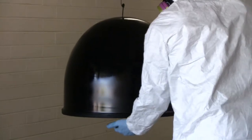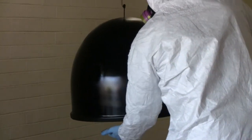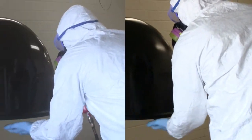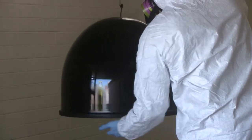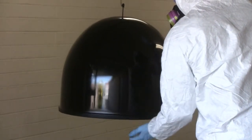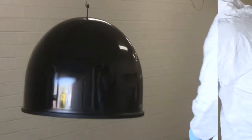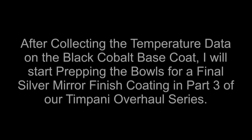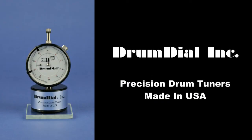The black cobalt paint is used in rooftop solar water heaters because it absorbs and holds heat very well. The fiberglass bowls I'm using are minimally conductive and will still transfer a little heat — they'll transfer heat much better, especially after this type of coating is applied. They'll never be as good as copper, but we can certainly get close. If you watch closely, I'll spin the bowls faster and faster as I apply the paint in order to get as high a gloss finish as I can. I have to be careful not to apply too much paint all at once, otherwise it will run and will have to be sanded, buffed, and refinished. After collecting the temperature data on the black cobalt base coat, I'll start prepping the bowls for a final silver mirror finish coating in part three of our Timpani overhaul series. In the next video I'll show you how to put a real silver mirror finish on your timpani bowls.